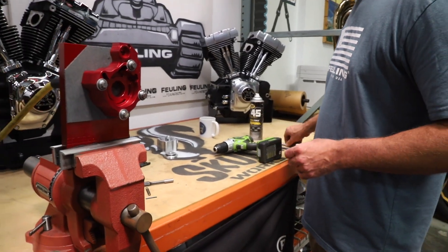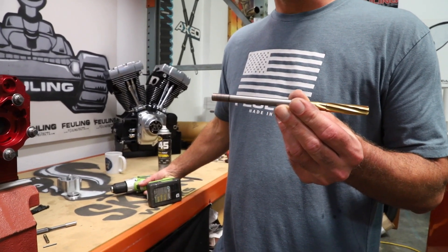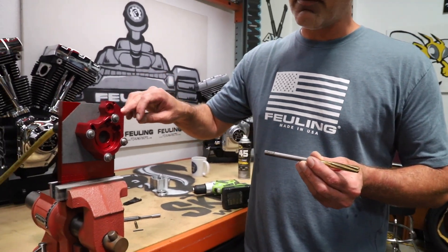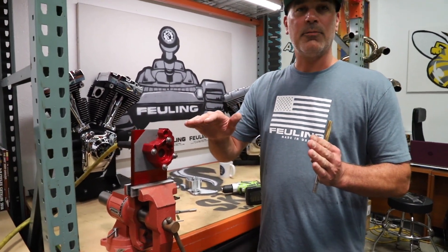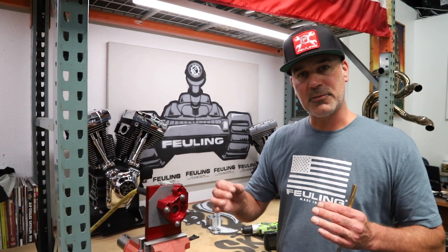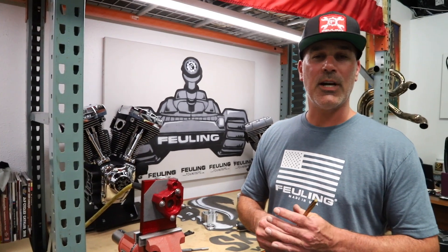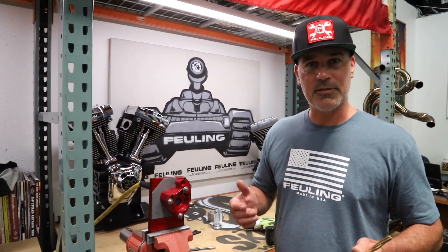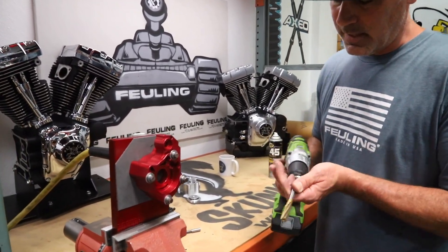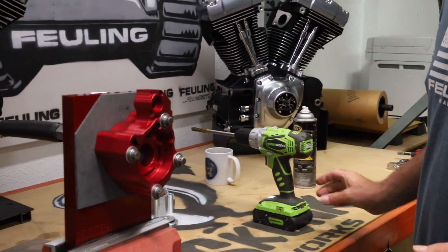If you need to clean up the bore or re-seat it, this is a reamer that we sell — part number 9008, a 7/16 reamer. You can go down in there and clean up the shelf. What we like to see is the shelf and the bottom of the bore squared off as best as possible, because that's going to create a smaller seat which requires less spring pressure to hold the valve down and seal it. This is very similar to doing a valve job in a cylinder head. This tool is especially useful if you've got an oil pump where debris has flowed through and damaged the aluminum seat.